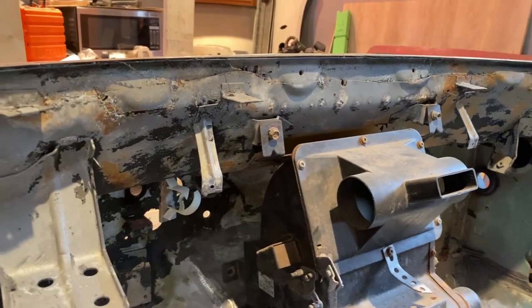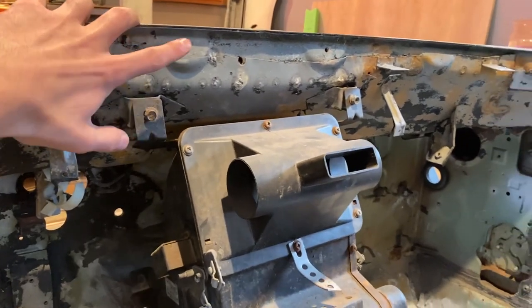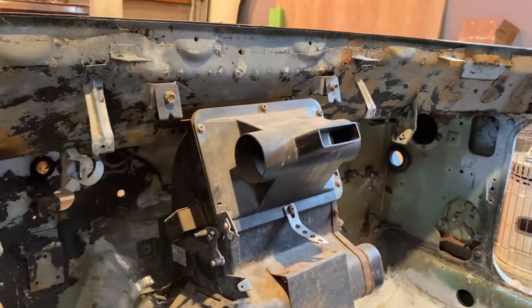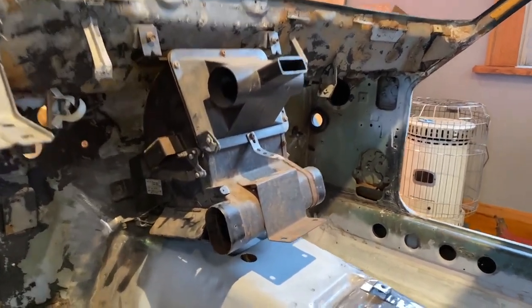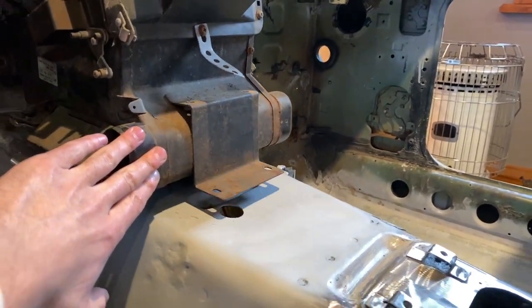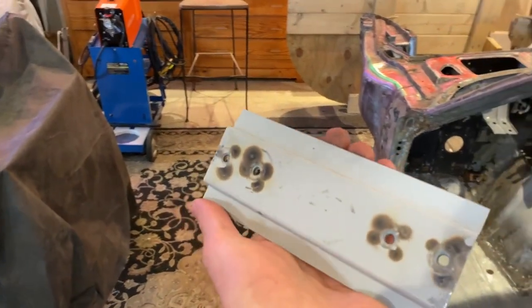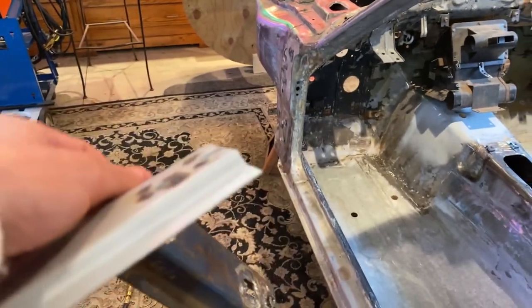So that's also super annoying. If I'm going to keep this piece I'd fix all the welds, take care of all the rust they didn't seal, but I've got to mock up before I even get to the paint stage — mock up all the heater controls because if it's off even a couple millimeters all the brackets can be thrown off. What I did is I made a new bracket — I slimmed it down. Here's the original; you can see how much thicker it is compared to the new one.